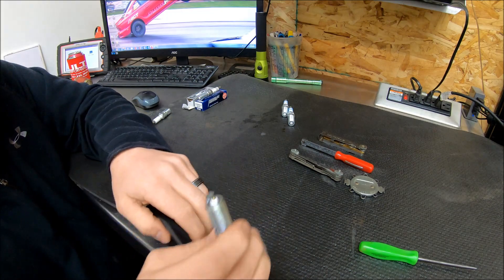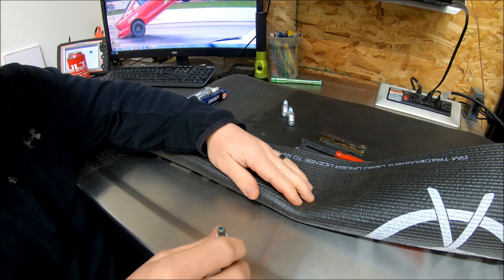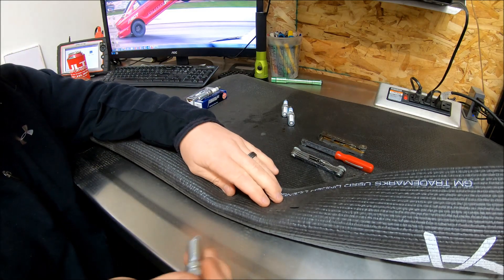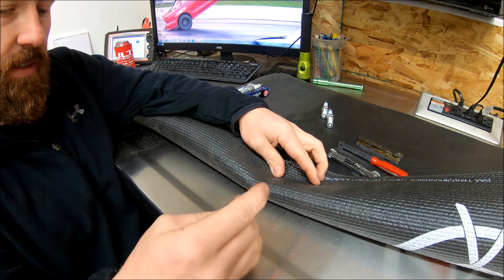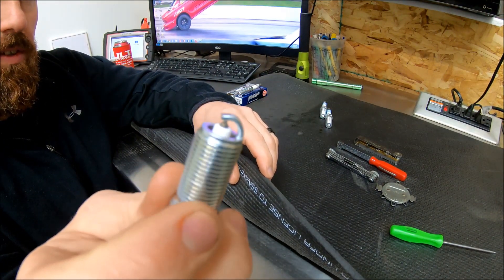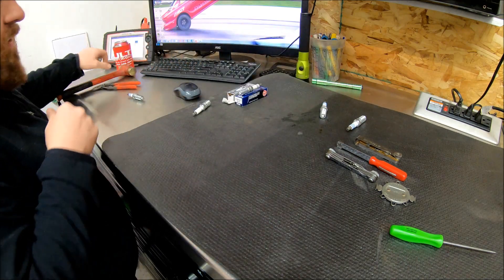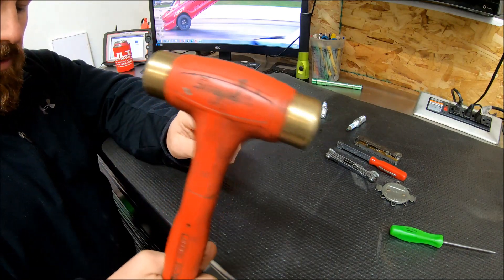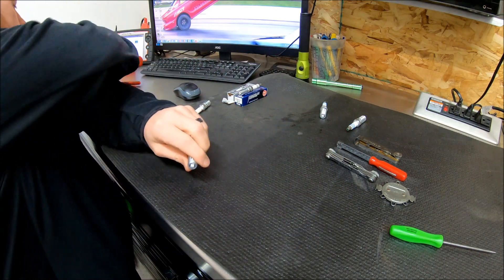Different methods of closing the gap down a little: if you are gentle, just find a nice hard flat surface and tap them down gently like that until you get them closed up some. You don't want to make it an Olympic sport and go BAM BAM BAM — next thing you know you've got a plug closed into the electrode and you've probably broke it. Very delicate feel with it. Another tool you don't want to use: a hammer does not make a good plug gapping tool. As you can see — even if it's snap-on and really nice — not the proper tool.